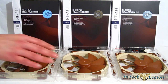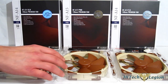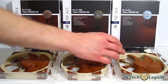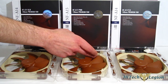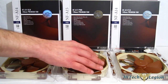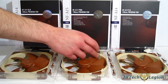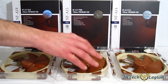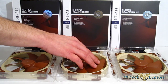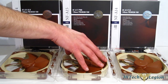Taking a look at the common pieces, we're going to see that they all use the AAO frame — the Advanced Acoustic Optimization frame — which has a stepped inlet as well as inner wall dimples. This is going to create more turbulence coming in and give you less suction noise from side flow. The blades use air channeling, which speeds up the air around the outside, also giving you less suction noise.